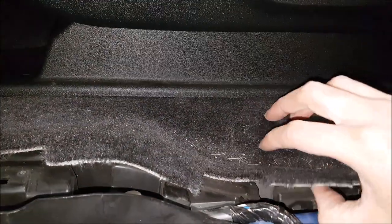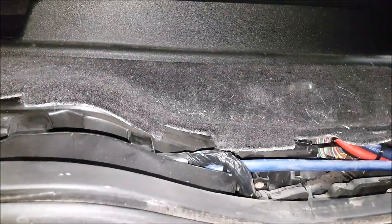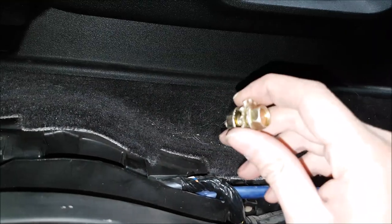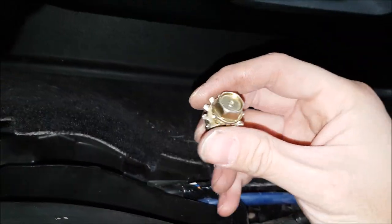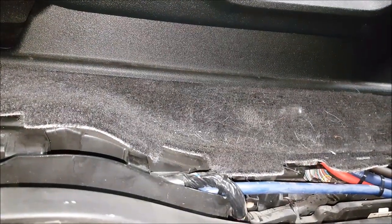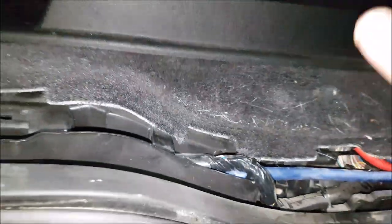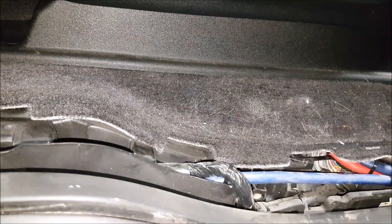The next option would be my least favorable — I wouldn't recommend it — which would be hitting the floorboard. This is common practice in steel body vehicles; we use a bolt with a different thread pitch so it can thread itself into the sheet metal, and you can nut it on the other side with a lock washer. This works really well and 98% of our installs in a high-volume shop use something like this — it's 100% acceptable. The reason I don't like doing it on a vehicle like this is because aluminum deteriorates very differently than steel over time.